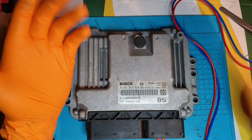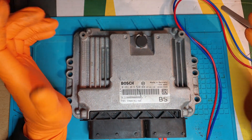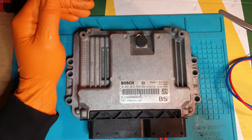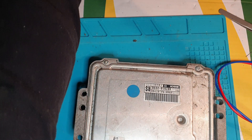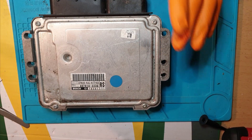This is a completely induced fault via idiotic behaviour — that's probably the best word for it. Don't go pairing ECUs up with boost packs on the bench, especially if you've never done it before and especially if you don't know what you're doing. And even then, you do not power CAN lines.